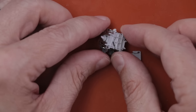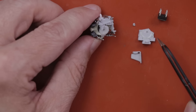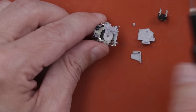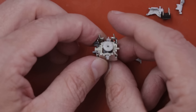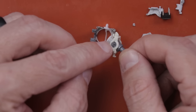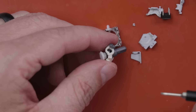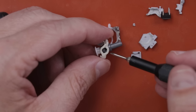This is definitely not coming apart how I thought it would — it's just kind of coming apart in pieces because it's all busted up. This little piece right here might have broken off of that. Now we can see the very inside of the analog stick. If you look on this side, this piece is just sitting down inside flush with the white piece, but this one is sticking out because it's broken. That was the cause of our problem — I'm glad we could figure out the exact cause.